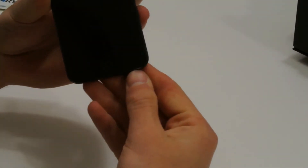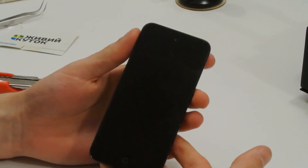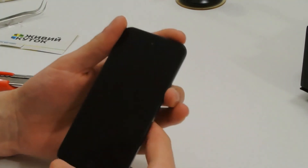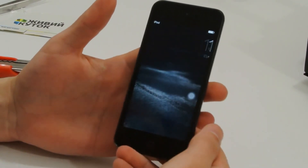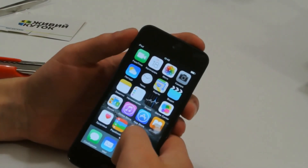Repair is finished. The paint is damaged a little here at the corner, but everything else is fine. My advice to people who will repair such an iPod: do not open the ledges — it is better to disassemble the glass from the frame and later put it back with glue. This way is better. Thank you for your attention, watch my videos, subscribe to the channel. Goodbye.